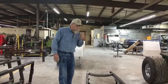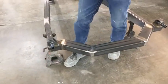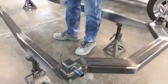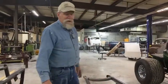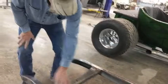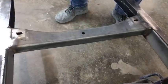This one here is set up for coil-over shocks. A lot of the cars had transverse leaf original, which we can show you in a minute, but this is set up for coil-over shocks with your bolt holes and reinforcements. It doesn't have a cross member in it — this is just a perimeter frame. The customer wants to weld a lot of the brackets on it, so he's going to have a four-link rear suspension. He'll probably have a nine-inch rear, and on the front it's set up for a drop axle, so the cross member for the drop axle has been welded in.